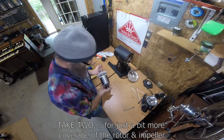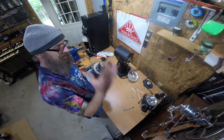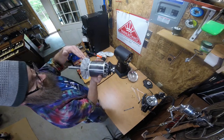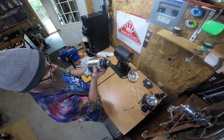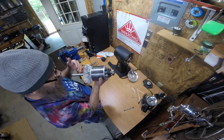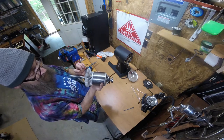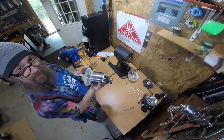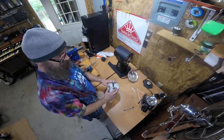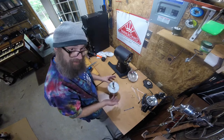Looking at the rotor — front and rear bearings allow it to spin. Be careful with the pieces on there; they're not easy to reassemble if they come apart. The main thing to worry about: the impeller is press fit and it can move. If it moves out of place, there's almost an etched line — really it's where the polished part of the shaft stops and there's a hazy part of the shaft. That's where it goes. If you have to reposition the impeller, use a soft mallet and a large adjustable so you have something pressing on it to tap it into position.